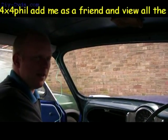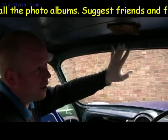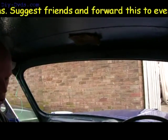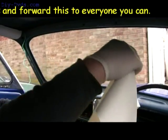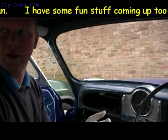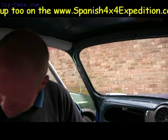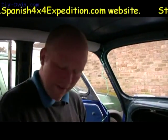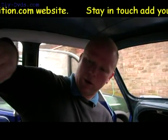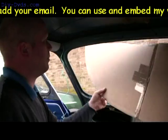It's not quite so quick getting it back in. Anyway, that's on the bodywork DVD. I've sanded this up with 80 grit, ready to go. I've cut me a nice long strip of material off the end. So now we're gonna glue that up. Take me rubber gloves off. Now I'm cleanish. Get the glue. Get the cardboard, so I don't want it all over the paintwork. Stick that up.